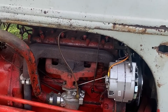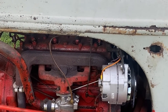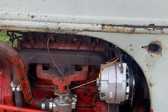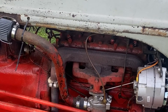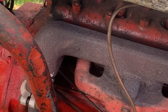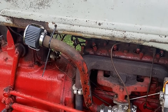I did order the igniter from Amazon. I got this thing running, and it was running pretty good, but I was still having that high chatter on top end when revving it up. I thought maybe the governor was just too tight, so I put the old governor on it. I ordered the carburetor — I'll put the link below — adjusted the main throttle out two turns, cranked right up, and I've bush hogged with it several times. It is definitely an improvement.